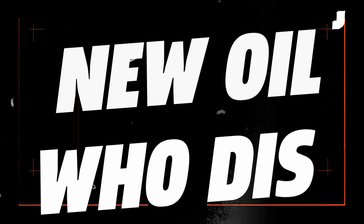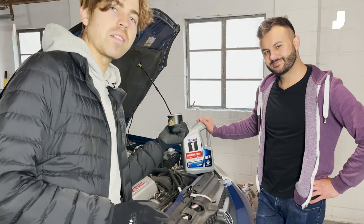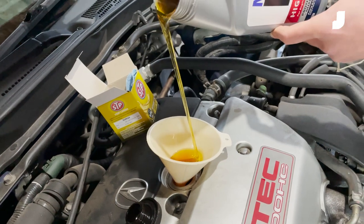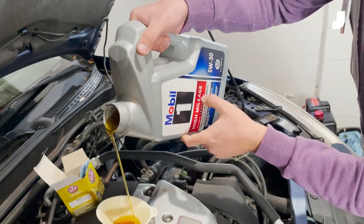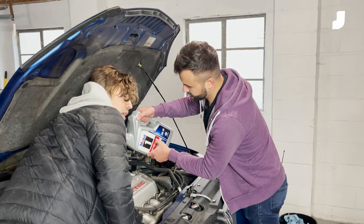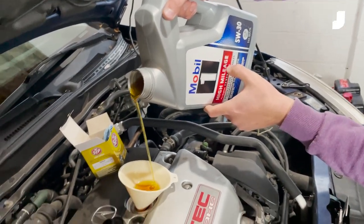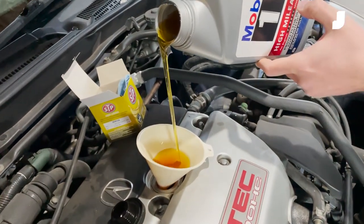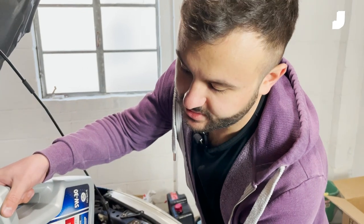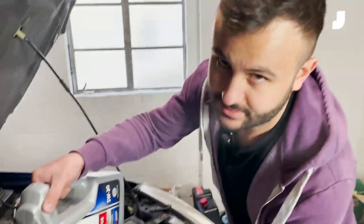While I screw the oil filter back on, Christopher's gonna start filming himself with this lovely Mobil One 5W30 — a lovely flavor. Don't over-tighten your oil filter. You make contact with the block, then go three-quarter turn past it — just in the realm of hand-tight. Don't go crazy. Synthetic generally flows better at lower temperatures, but apparently not as much as I'd like through this very small funnel. If we were doing this with conventional, honey, we'd be here all day.